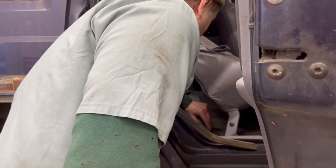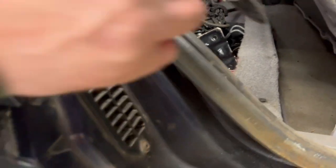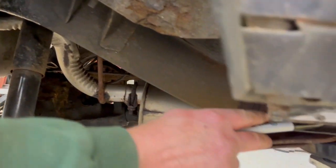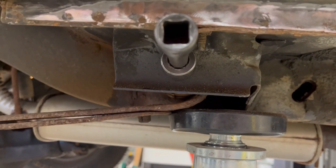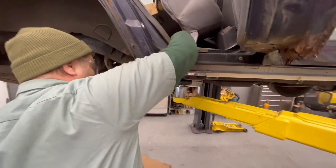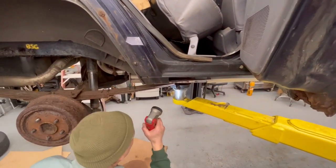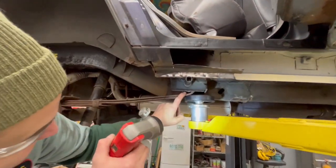All right, is this a prep? What kind of prep are you doing? Well, so basically what we're going to do here — the leaf spring is broken — so I'm doing a quick look to see what's going to catch on fire when we heat up the bolt and the nut that's holding the front of the leaf spring on. Because if that breaks off from the frame, the scope of this project changes dramatically. Watch — if you see smoke coming out of this area a lot, we need to dump some water there. Smoke out the top is bad. The spring is broken right here, that's what we're trying to fix.